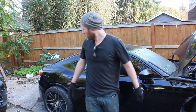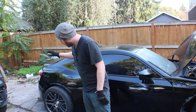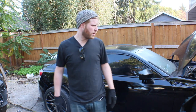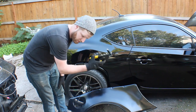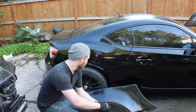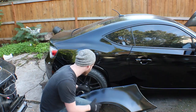Rear bumper's on. It's going to need to be trimmed in the same way that we trimmed the fender, but I'm going to do that after I put the larger over-fenders on. So next up I'm going to grab our Rocket Bunny wide body over-fenders for the front and the rear. I've got our rear over-fender here, and I've got our rivet gun and our trusty aluminum rivets. I'm going to go ahead and rivet this one to the car. Exciting times — been waiting to do this for a long time.